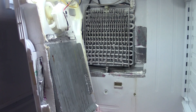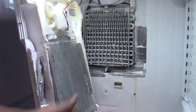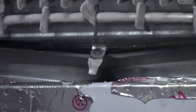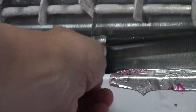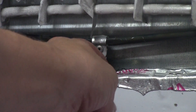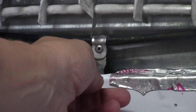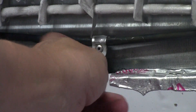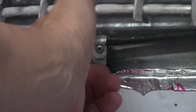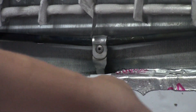So what we're going to do today is actually try and put one of those little tab extenders on this little tab right here. See that little metal tab right here that I'm touching? It's actually clamped on to the heater coil. That darker colored tube is a heater coil, and the concept is it transfers heat through that little tab into that hole, which helps prevent the ice from forming.